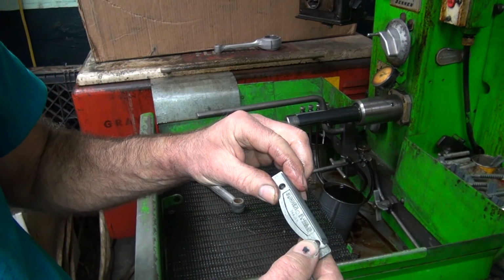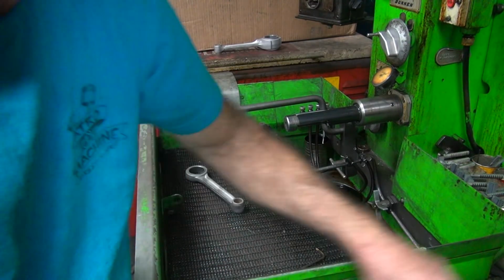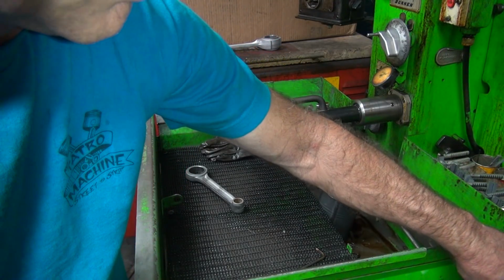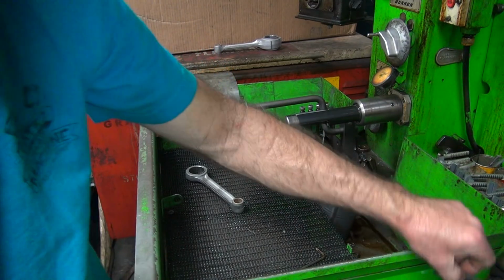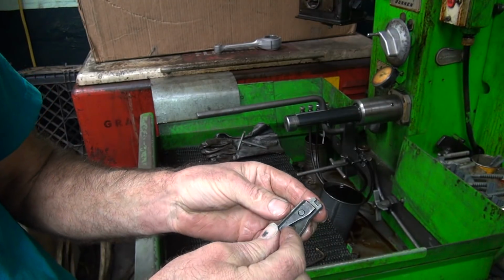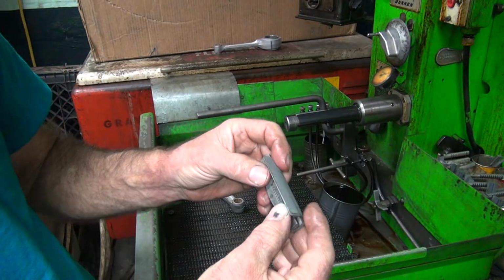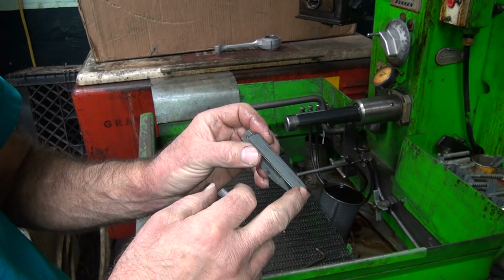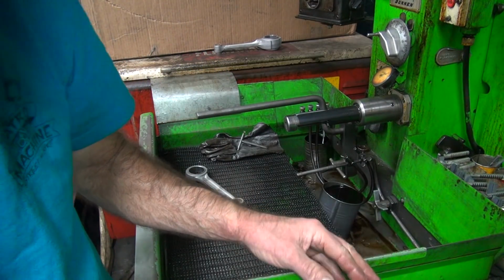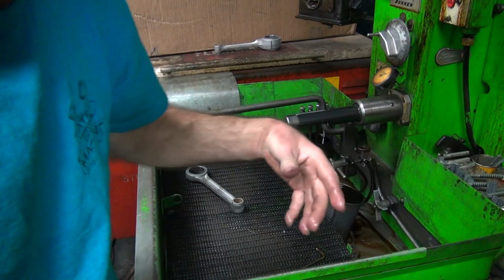Okay, I'm going to take this real fine one here, 83. And we're going to call this a rod one. Stick that right there. Now, every one of these, you've got to make sure each one of these wedges goes with certain stones, because everything wears to that wedge and the mandrel. That's why you can't mix these. They wind up cutting real heavy on one side, not the other, when you mix and match, because every tool has a different tolerance of fitment to it. Okay, so now I've got stuff all organized again.